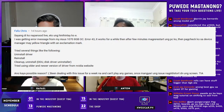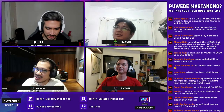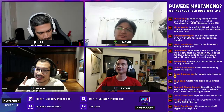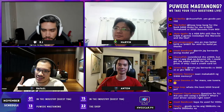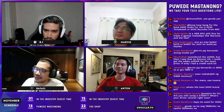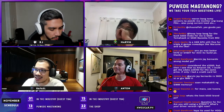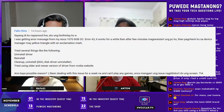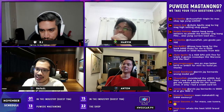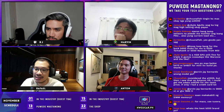Sorry, when I read this question, I thought it was the motherboard because there was an error 40, an error code. But no, it's the GPU. Yeah, it's the graphics. Error code 43 only shows up in two scenarios. One scenario is that one of the component's drivers is not communicating well with the hardware, so software. Second is a physical hardware problem. So if he already tried reinstalling the drivers, it might be a hardware problem, a physical thing that needs to be looked at. So we would recommend that you go to a shop, or if you have a spare old graphics card, insert that in and see if it works. That's the best way to troubleshoot, isolating the problem. But it must be a hardware problem.